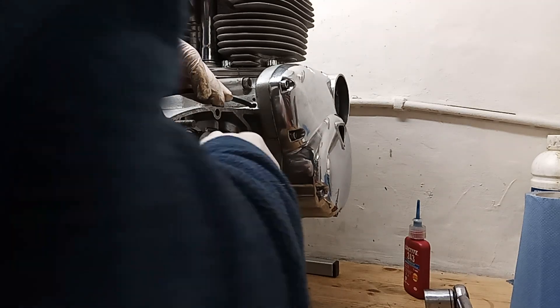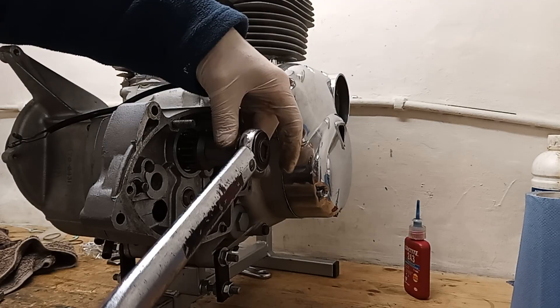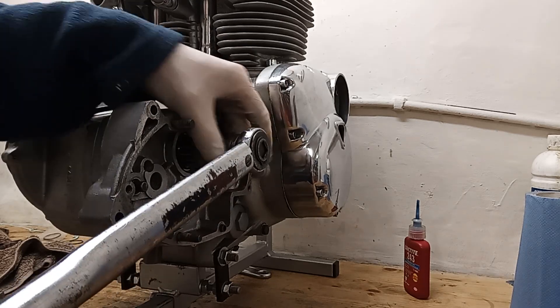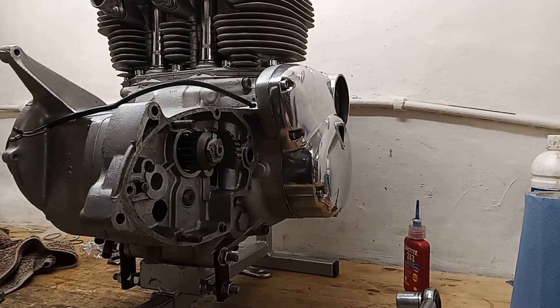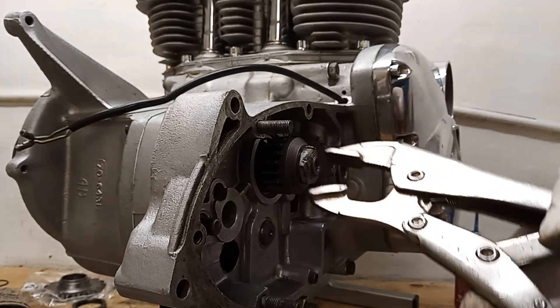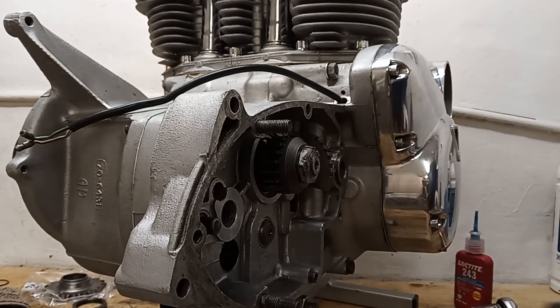That's the reason for doing up the nut first to seat it, then taking the nut back off, because otherwise you're fighting a spring and this lock tab washer can easily become unseated. Right, I've got my cunning plan - that's holding the main shaft perfectly. There we go - 45 foot-pounds. The manual says 40 to 45 and I always do them to 45 because I really don't want that nut coming off. I'll bend the lock tabs down with a pair of molegrips - there we go - and that's done. Now we can put the rest of the bolts back on the inner cover and then put the outer cover on.